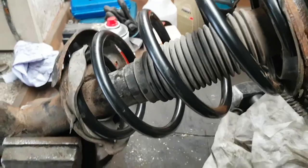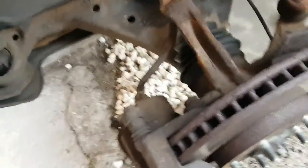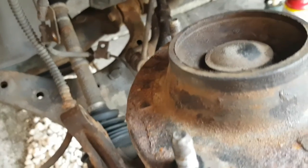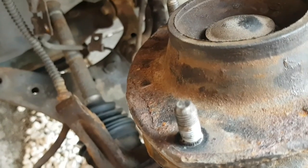That's the spring on. Now what I've got to do is go fit it to the car. To put it back on, you want to make sure that's pointing forward, so it hooks onto there. Try and do this one-handed, it's a bit of a nightmare. So make sure that's pointing forward. Try and make sure these match up at the top, and just lift it back up and put the nut back on. You can just get the nuts tightened on all three, and you're all good.